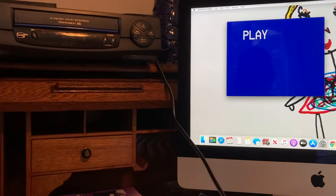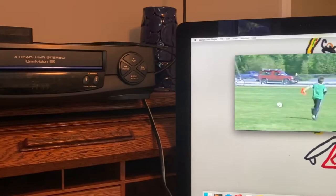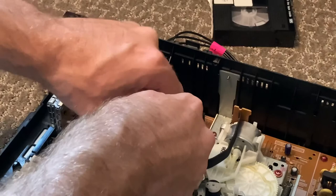Boom — look at that, no snow! That took care of it. If it happens again with the next tape, rinse and repeat: clean the heads manually with paper, then use the VCR head cleaner tape and alternate back and forth. Old tapes may leave deposits on the head, so it might require cleaning before playing every VHS tape. Hopefully that helps you — it worked for me. Don't forget to hit that like button and subscribe to the channel if you want more DIY solutions.